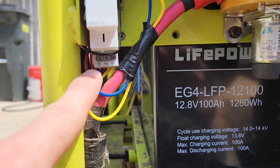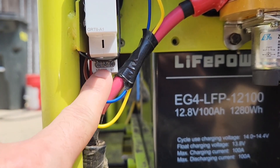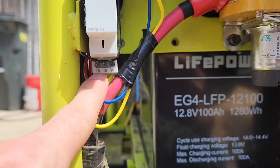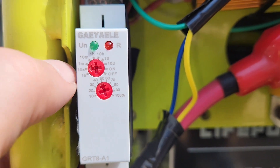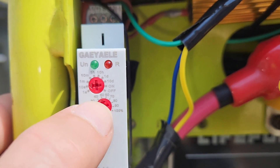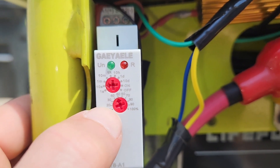The key provides the positive, and also provides the jumper for the relay. So when you first turn the key on, terminal 16 is energized. I have it set for five seconds — on the 10-second mark with a 50% rating, so 50% of 10 is five seconds.